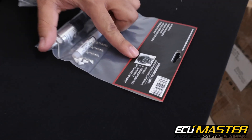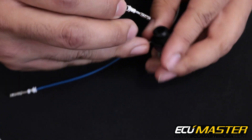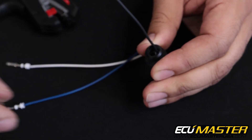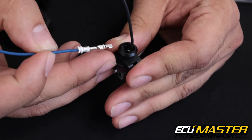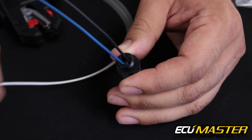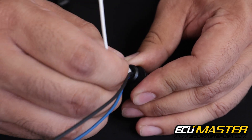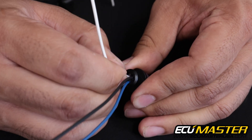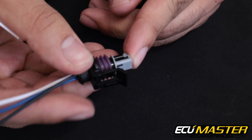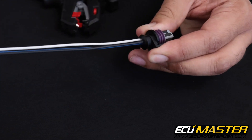Let's take our package and look at the back side for our sensor pinout. We'll start with position one, which is our sensor ground — insert the terminal in until it clicks, nice positive location there. Next, pin assignment two, which is our 5 volt supply to the sensor. And last but not least, pin three is our sensor output or sensor signal that goes to the analog input of our EMU device. Now that you have these clipped in and locked, take the gray tab and press it until it closes, and now the tabs cannot come up. And that's how you wire the three position sensor.